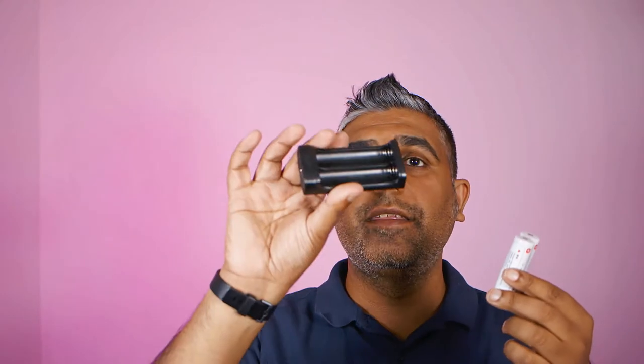The next two items are the batteries and the charger, which charges via USB-C. One thing about these batteries is they are branded — you have to use their batteries, which are 18650 batteries at 2600mAh and 3.6V. If you're going to get replacements, look for that spec or maybe slightly higher. Let's plug these in — one on each side — they light up, so I'll leave them to charge for a moment.